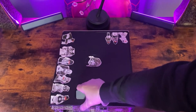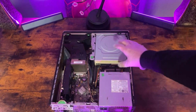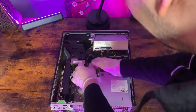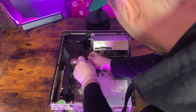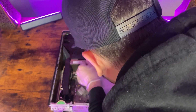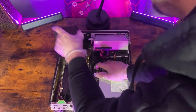First things first, we have to take off our side panel. Next, we have to lift up our optical drive just a bit — that should do it — and then unhook our SATA and power cable, everything that is in this fan trough, and move it over to the side. Next, the fan trough should just slide out, like so.